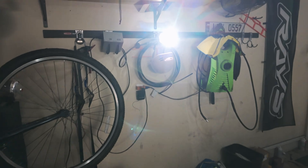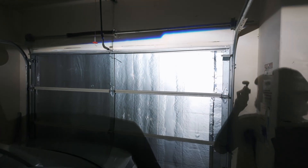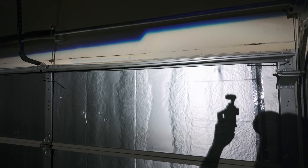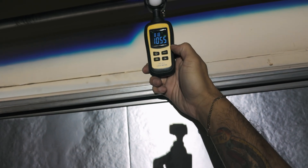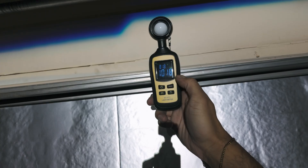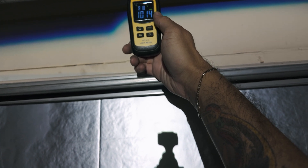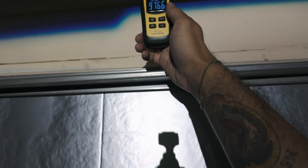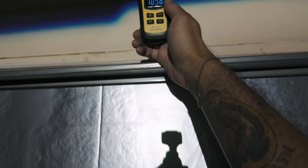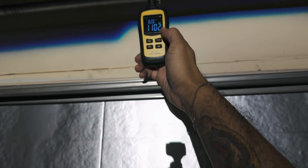That's with a regular Philips bulb, so let me switch that over to an Osram CBI real quick and see how that changes things. This is a CBI with a lot of miles and a Morimoto ballast that isn't too happy. Trying to find the right hotspot here — probably 1100 lux right there. So 1100 lux on that, which is crazy because the LED projector put out more.